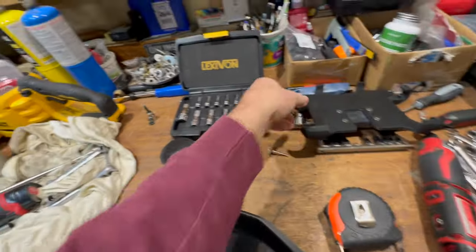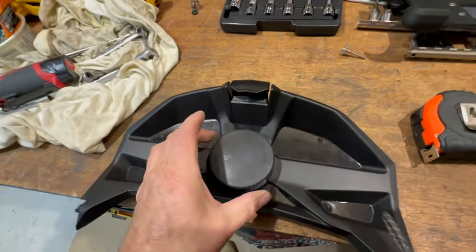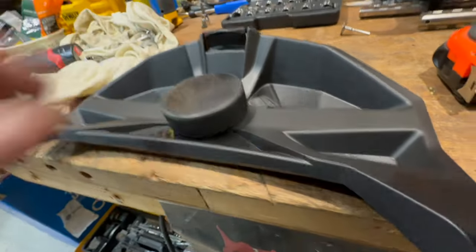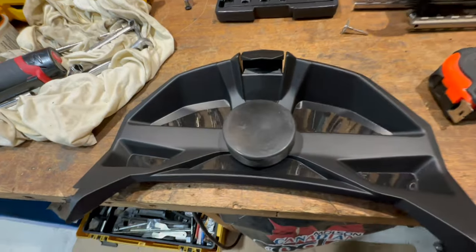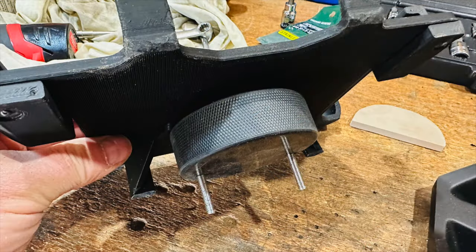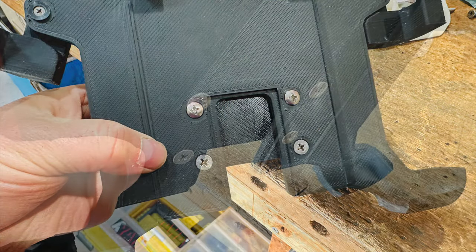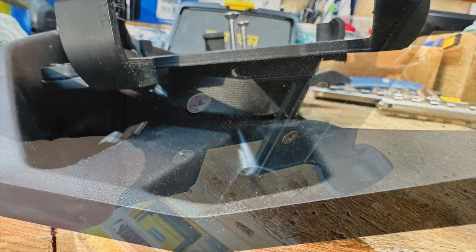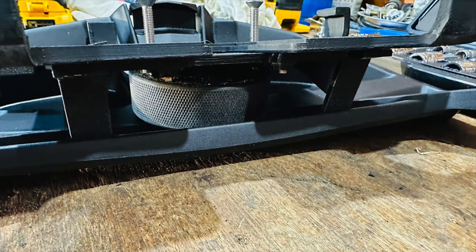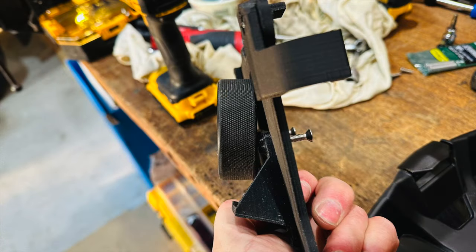It's thicker than a hockey puck — just so you guys know, a hockey puck is exactly three inches diameter by one inch thickness. And on this BRP extension it just sits right in there perfectly. I mocked it up a few different times, tried to get the angle right because it does have to be on a slight angle. I ended up using three stainless steel flathead bolts, 10-32 in size. One of them is one and a half inches long and two of them are one and three quarter inches long. I used nylock nuts and washers, all stainless steel to match.